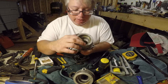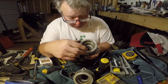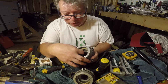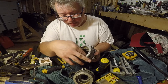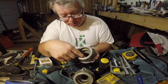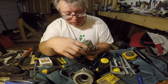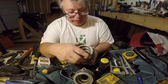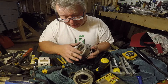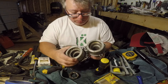Just make sure there is no rough edge. If you look down inside here, you don't want to take any sandpaper because if you look there there are very, very small ridges and you don't want to damage those ridges. Just clean it up real good with some brake clean or maybe even some diesel fuel, and clean that guy up really, really well. Either one of these is fine — they are both the same.